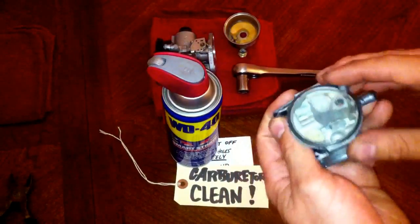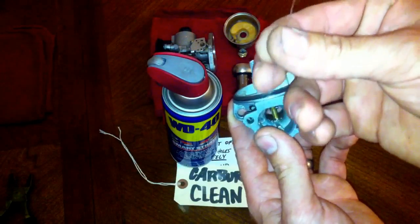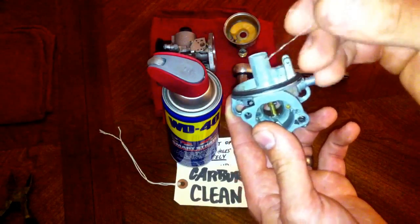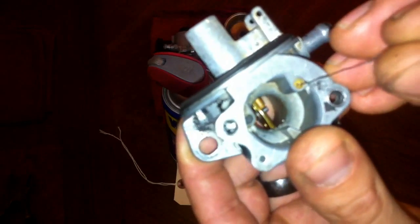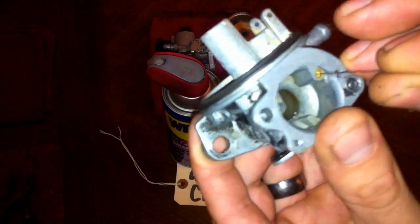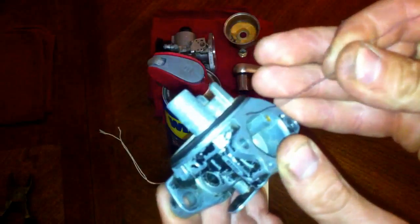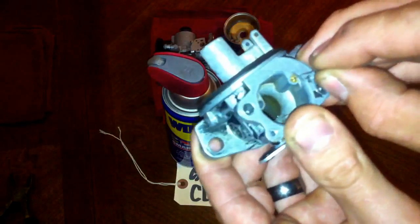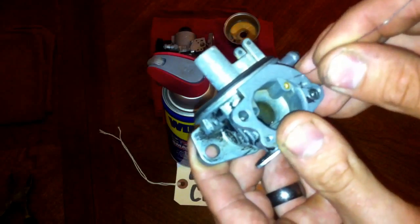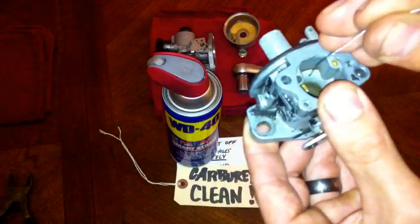Once you're sure you've hit everything, take a bread tie. Burn off all the paper or plastic on the outside, pull it off, and you get a very small diameter wire that you can feed through these holes. The one you're going to be especially thorough with is right here — that little brass part — and it goes in about an inch deep. Feed that wire through as far as it'll go; mine went about an inch to an inch and a half. Sometimes you'll see some blockage — make sure you can get through that. I've used staples from a stapler before, just straightened out. Don't get it stuck inside there; make sure that hole is clear.